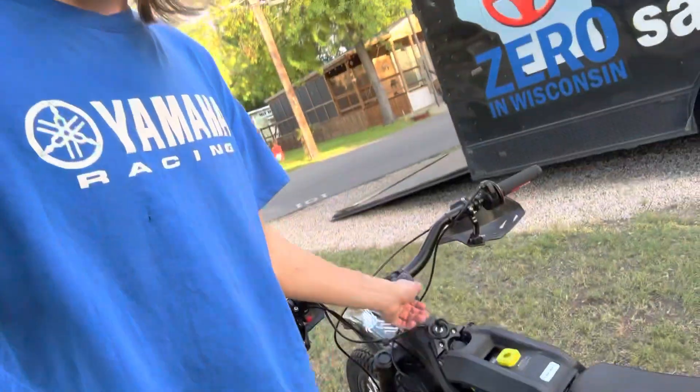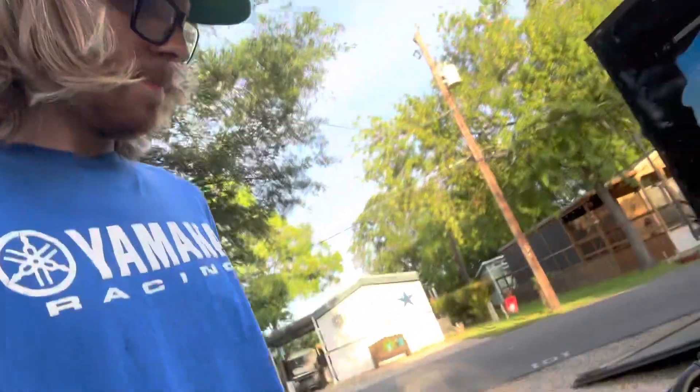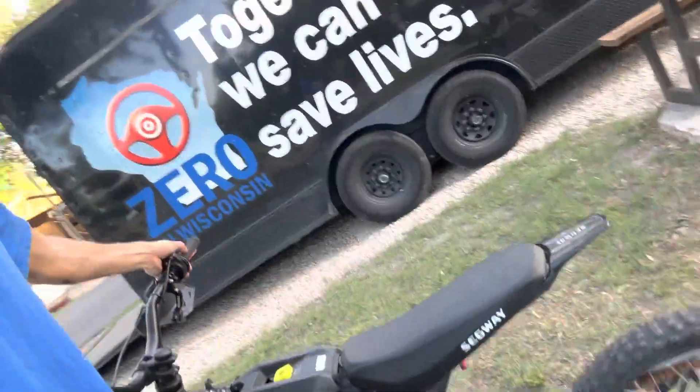Watch right here — my Segway runs now. Fire it up, and we're going. I just bought this thing non-running, one unplug and I'm cruising. So again everybody, check out that tip-over sensor if your Sur-Ron or your Segway does not run.